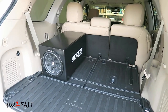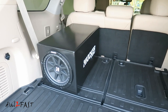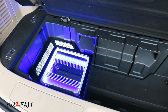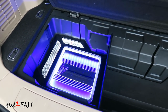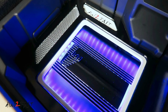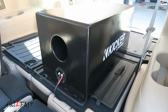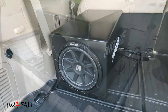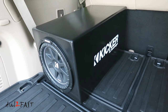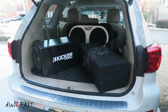The installation is now complete. In this video, I showed you how I built the subwoofer box, how I installed the amplifier, and built the lighted accent cover. I did spend some time to adjust the gain on the amplifier so the sound of the subwoofer matches the sound coming from the factory speakers. If you watch the first video and this video, you'll now have a good understanding of how to install an amplifier and subwoofer into your vehicle while maintaining the factory radio. I might do a third video just to wrap things up and share my thoughts on the overall install and the different types of subwoofer boxes you can install in your car.